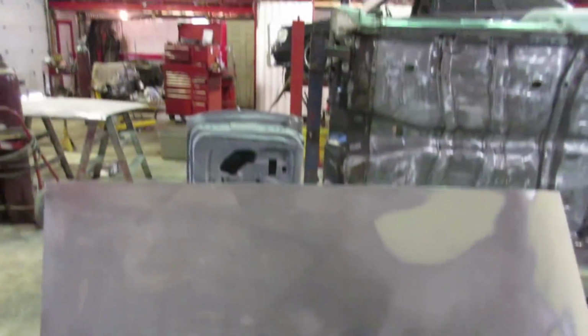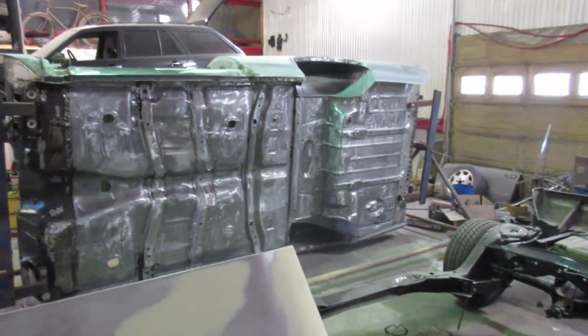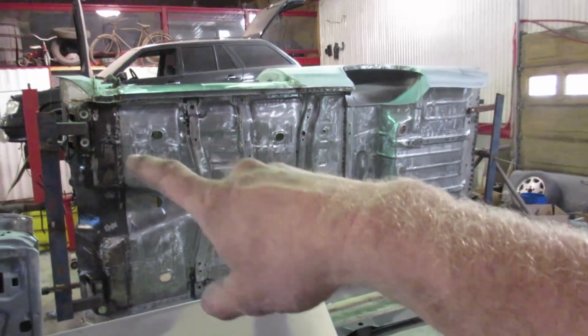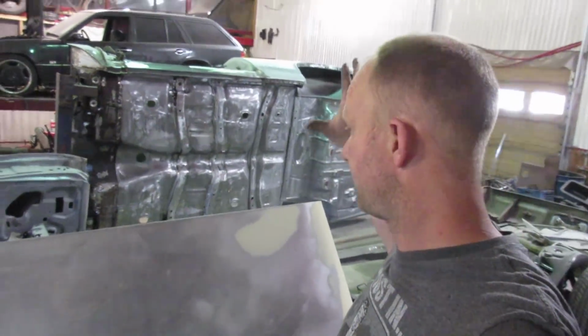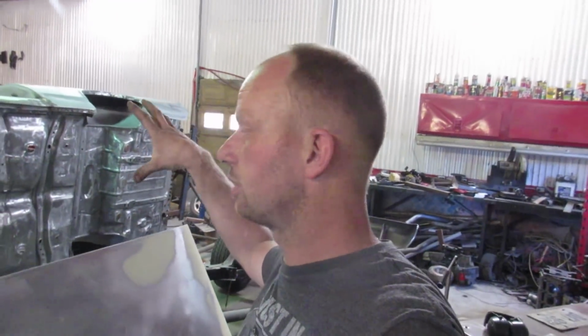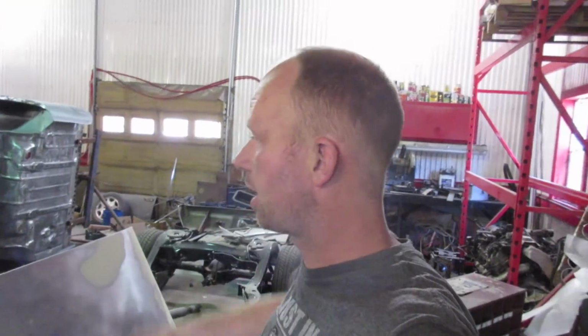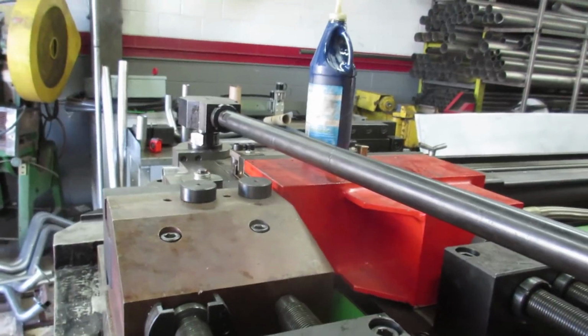As it sits right now, I need to spend probably 10 hours on the body itself, just doing the last couple finishing touches on it, and then we're throwing it in the trailer and it's heading to the paint booth to get the initial coat of epoxy put on it. Think of epoxy being a glue, so it'll glue the next layer onto the steel or whatever layer's on before that.